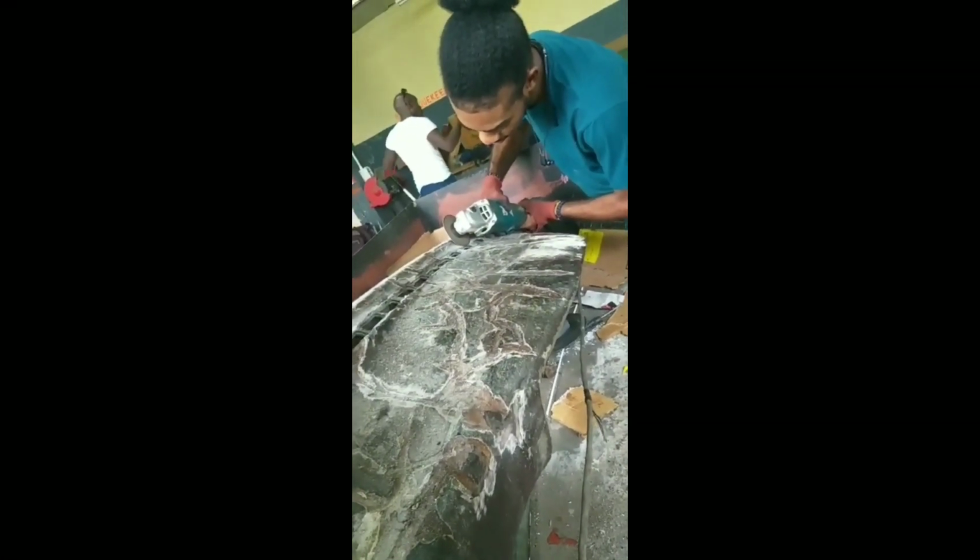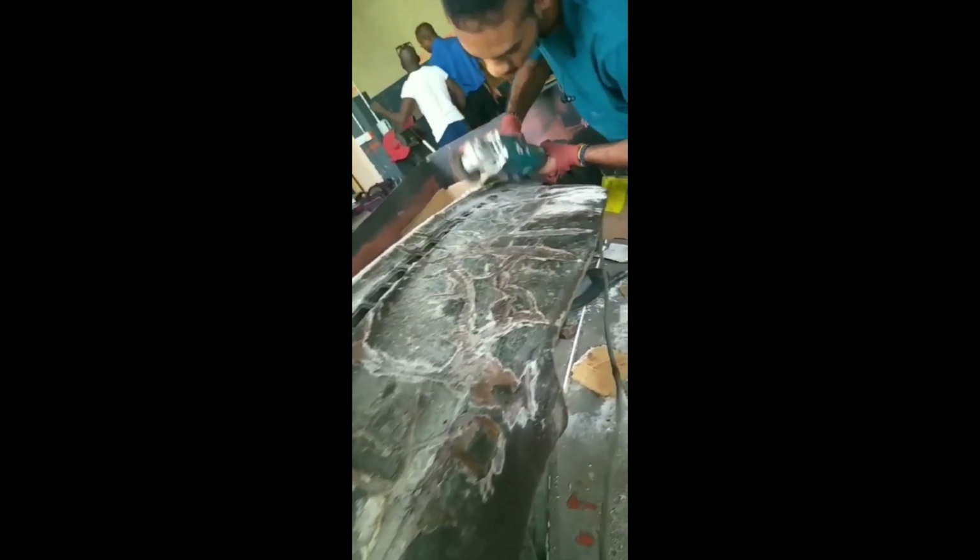To fix this, I had to use a blade and cut the cracks at an angle in order to form a ravine, making it easier for the body filler to level out the whole surface area for a smoother finish. The body filler is used because it's easier to work with and suitable for the molding process. In applying the body filler, it has to be done quickly before the hardener makes the entire mix too hard to work with. This takes both patience and skill to complete.